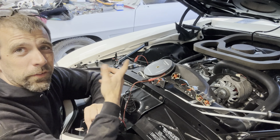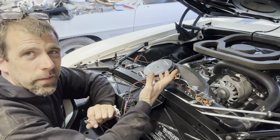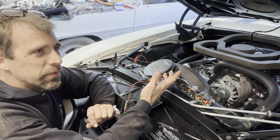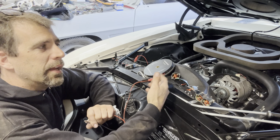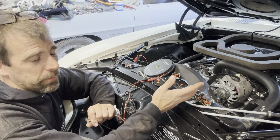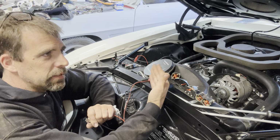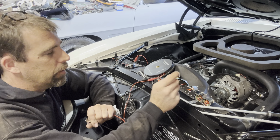And now, for the most part, that's all you probably need to know about fuel gauges. Oil pressure gauges work on the same premise: 0 ohms input, 0 PSI. And it creeps up to about 60 ohms, which ends up being about 40 PSI or something like that. I don't know the exact scale. I just know as the resistance increases, the gauge should read higher on oil pressure.